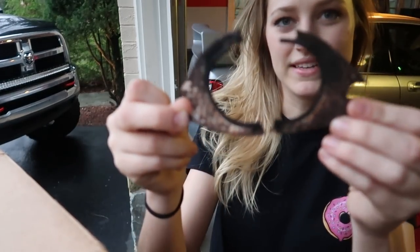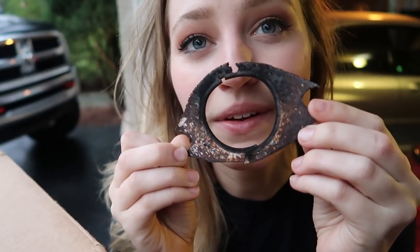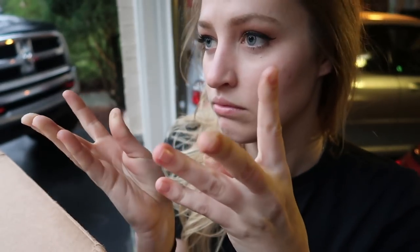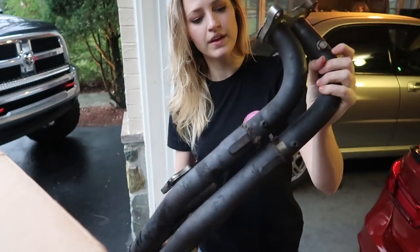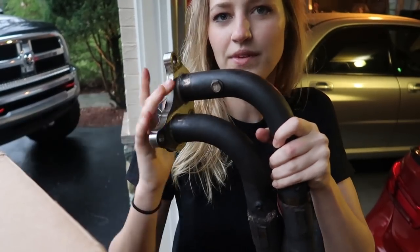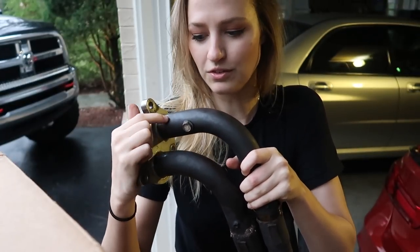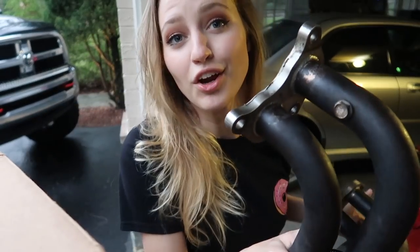These are my old up pipe gaskets — they are done. The up pipe ones are worse than the exhaust manifold to the engine ones; this is the worst one, these are nasty and gotta go. These are my headers — they're kind of rough looking. I'm thinking about cleaning them up before I install the heat wrap. You can see this is where there was an exhaust temperature gauge, and they went ahead and just gave me a bolt. I think this is a silly place for an exhaust temp gauge because you're basically only measuring one cylinder — if another cylinder is running too hot you'll never know.